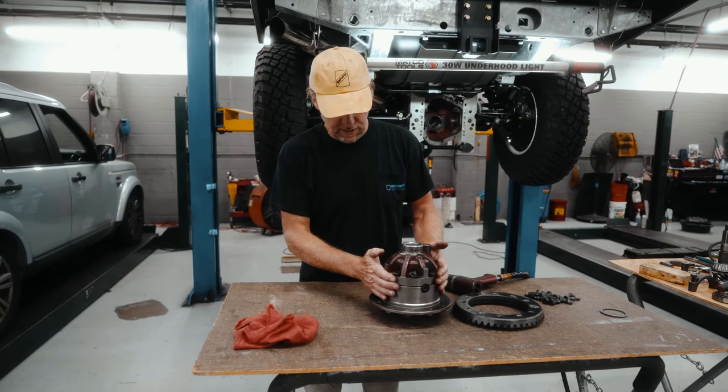All right, so that's done. Torque spec here, 110 foot-pounds, so a lot of torque on this one. Definitely gonna need an assistant here as well. And then we're gonna torque it down once again, crisscross, and then paint each bolt so we know we've torqued it down. So set this to 110.